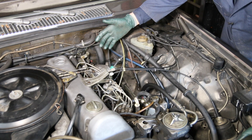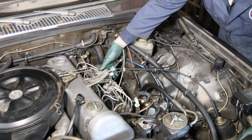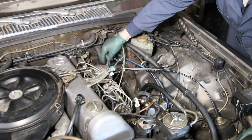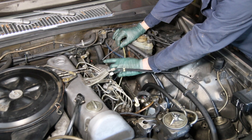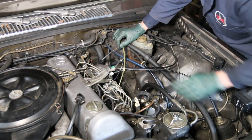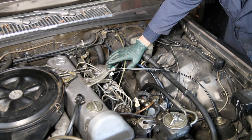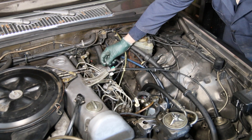On this 300, I got it out of storage, went to turn it off, and it wouldn't quit. I got down here and there's a vacuum line that goes onto the back of the injection pump for the shutoff, and it was just laying there — it had come off. The reason they come off is they get oil in these rubber vacuum hoses and they swell up. The oil is probably leaking out of the fuel shutoff valve; it hasn't failed yet, but that's a sign it might be close to failing.